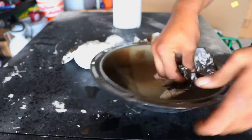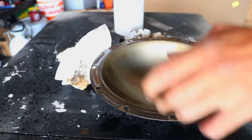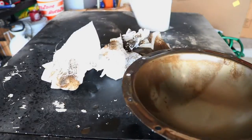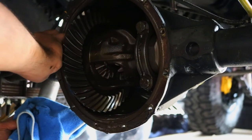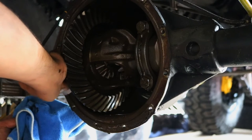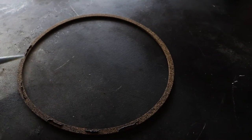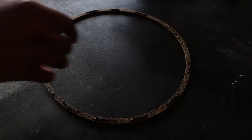I used regular paper towels to get most of the gunk off the rear diff cover, then used some WD-40 to give it a final wipe down to make sure nothing would interfere with the gasket and the mating surface. I used my straight edge to clean up any leftover gasket stuck to the face of the rear diff. To prep the gasket I used some mega black RTV - also oil resistant. You don't want to cover the whole gasket in it, just enough so it's tacky and doesn't fall off when putting on the cover.